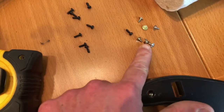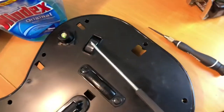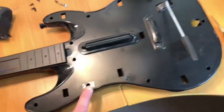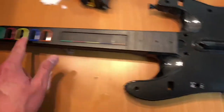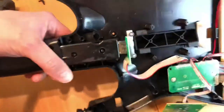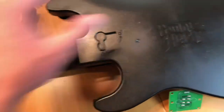These are the ones just holding the housing together. These are the six screws that held that little circuit board on where those momentary switches are. Also, right here is a little void-if-removed sticker. Chances are if you have one of these guitars it's not under warranty anymore, so who cares — pull all of those off. Also, when you're trying to take it apart, you're going to remove your neck, which is really easy to do. On the back side here there's a little lock — you hit it in the unlock position and it just pops right out.